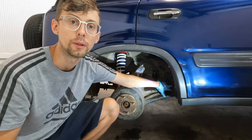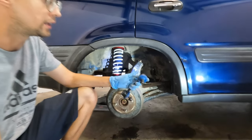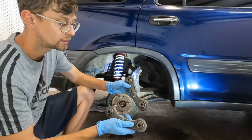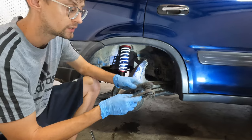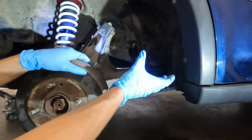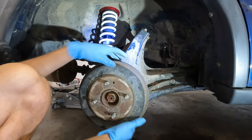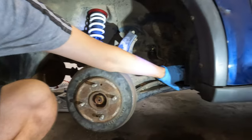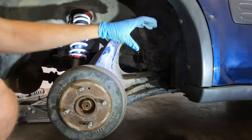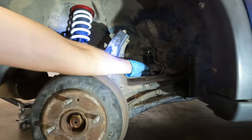So we just finished putting the trailing arm bushings on the back right side. Lastly, all I've got to do is install the sway bar end links — my rubber boots were torn so I won't show that. We also replaced the compensator arms, though of course you don't have to replace these. One thing to touch on: when installing your trailing arm bushing and clocking it, test-fit and position the trailing arm to where you think your wheel is going to be so you're not putting too much stress on the bushing. We had to take the bushing in and out a few times to get the angle just right on the other side, then match it up on this side. Don't forget to bleed your brakes, as you'll definitely have to disconnect your brake line.